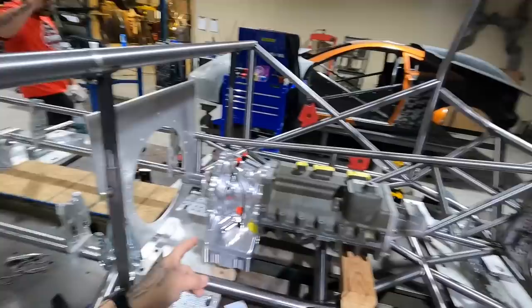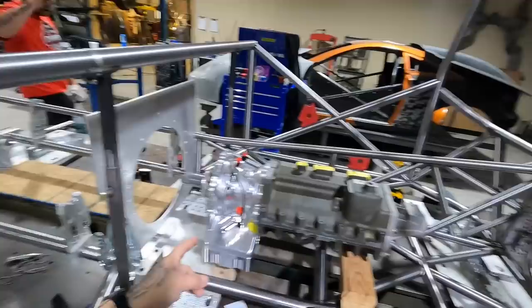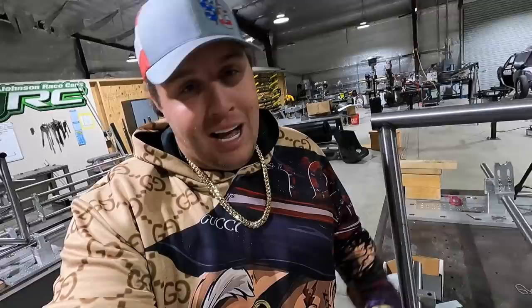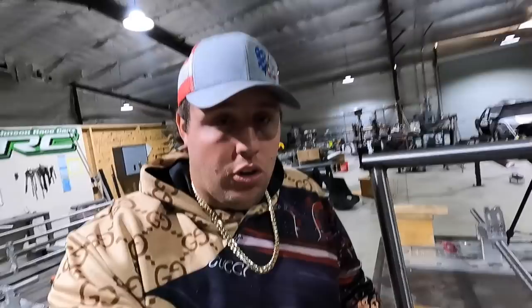Shout out to Quick Drive - they got me a spare Quick Drive this year, so Kyle will be able to swap them in and out throughout the season. Hopefully when we get done with our testing we'll like one a little better than the other. This one here is a non-lockup. All last year we ran a lockup Quick Drive with a lockup converter. We now have two non-lockup converters and a non-lockup Quick Drive. You get a 100-pound weight break if you run a non-lockup.